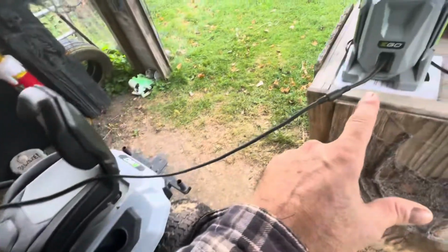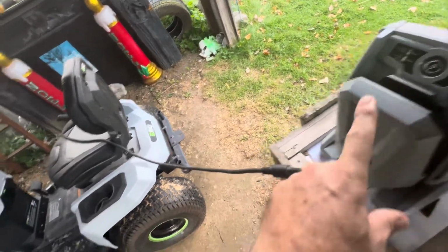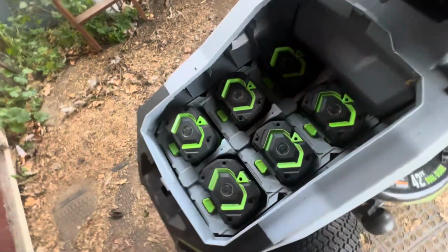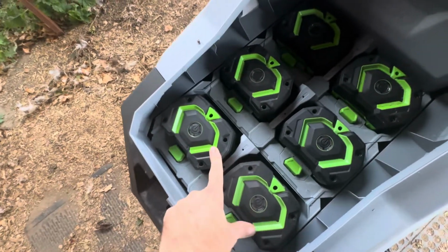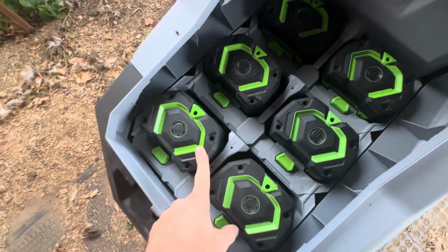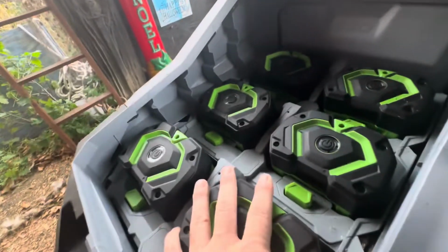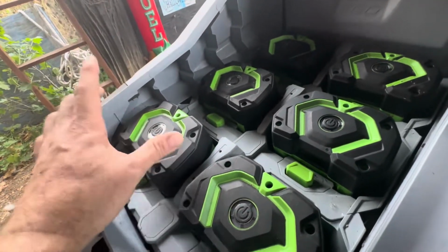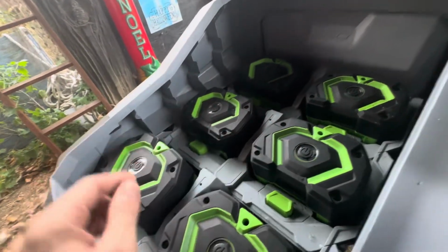The battery charger could recognize that one battery. It's like, oh, I see a battery, I should charge that battery. And by doing so, it started recharging the entire bank. So I didn't have to stick these guys in for the 2 hours, because as long as you've got one minimum battery that's above that threshold, the charger will see that battery and say, oh, I've got other things that I've got to charge. And I saved myself 2, 4, 6, 8, 10 hours of seating these things, right? To see if they would work. Whereas once I got this one going, and the charger saw it, it was able to charge them all at once. So I didn't have to run it through that 2 hour mark.